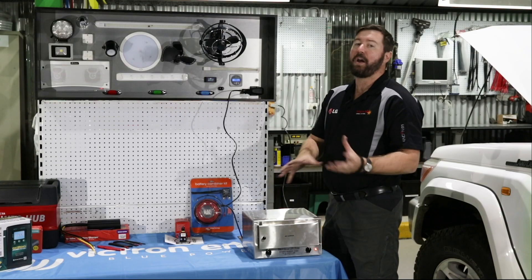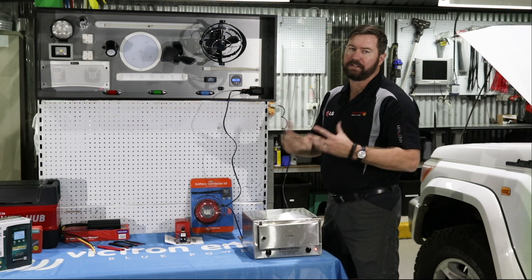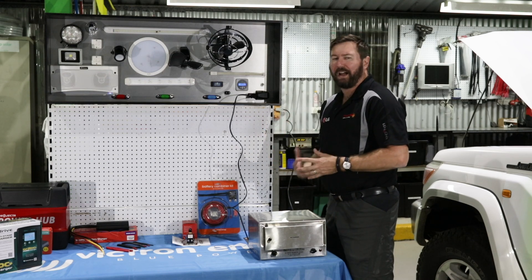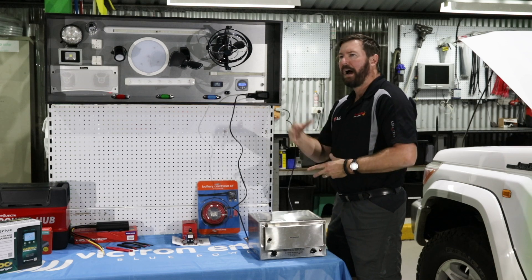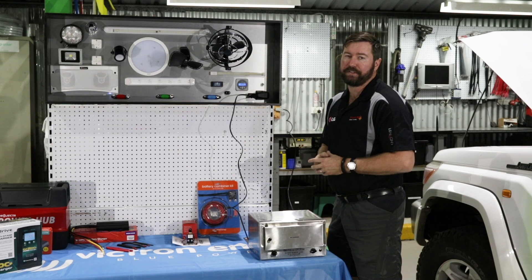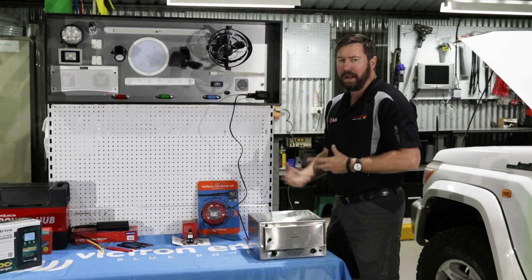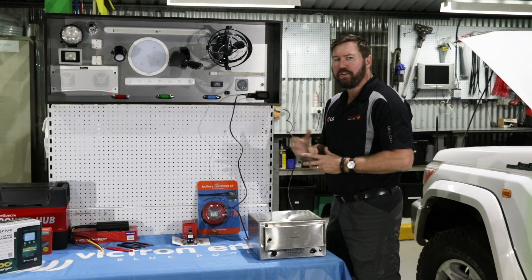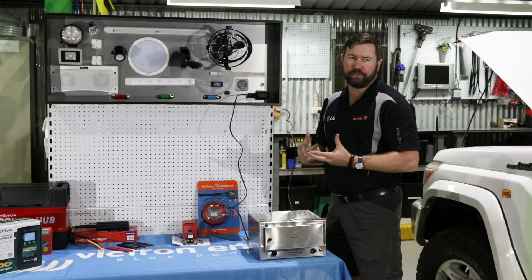Pick your destination, put a couple of frozen pies in there, and an hour or an hour and a half later when you get to your location, the pies are toasty and you're ready to roll. But practically running it while stationary — unless the sun's shining and you've got a big solar system — you'll struggle to keep up with it. Other cooking items that are impractical to run while away include a toaster or an electric fry pan. You can run these on large vehicles with lithium batteries and lots of solar, but on a small vehicle or caravan setup you're better off moving to gas cooking for these appliances. Those large heating loads should really be done outside on the barbecue, away from our batteries.